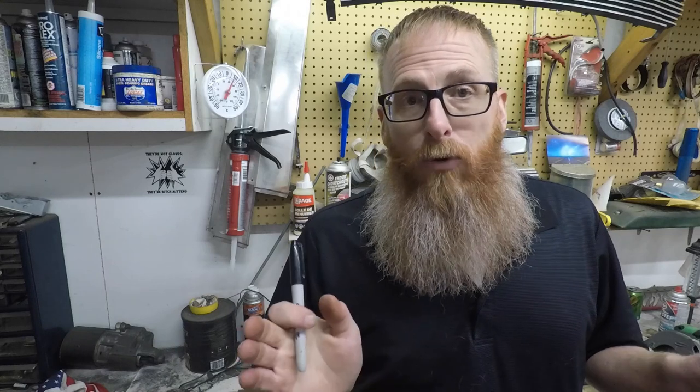The gas tank — we've got to install the gas tank, and I also cut the ground when I removed it, so we'll have to install a new ground on that sending unit. Patch the hole in the floor — if you remember back in one of the very first episodes when we started taking everything apart on Dale, there was a small hole in the corner right below where the seat mounts that we'll have to patch up while we have the welder here.